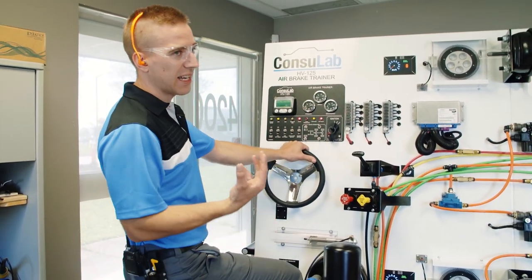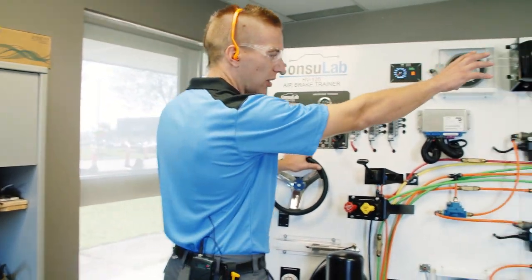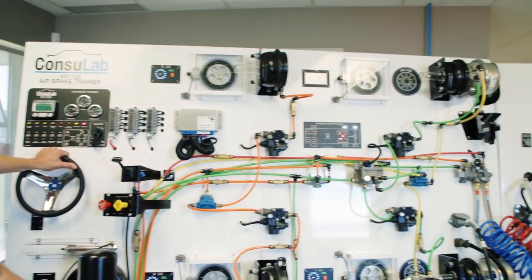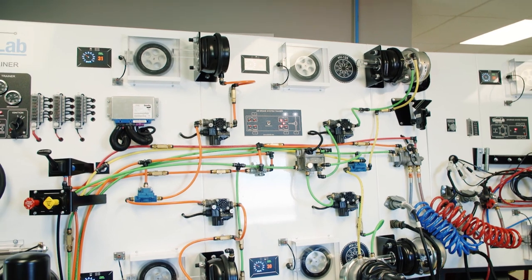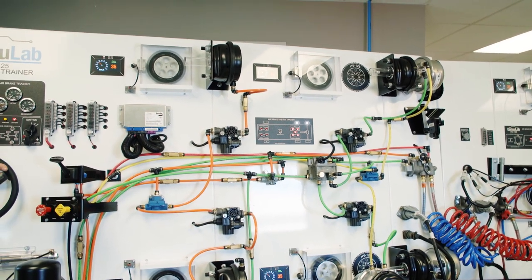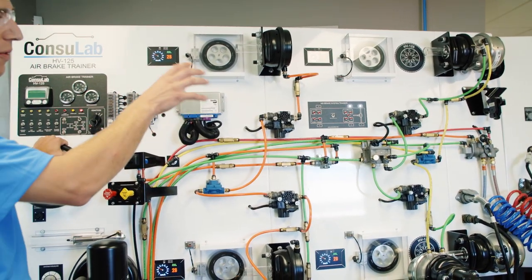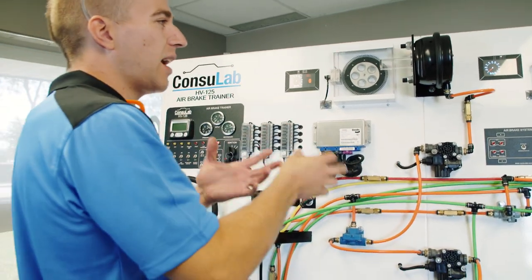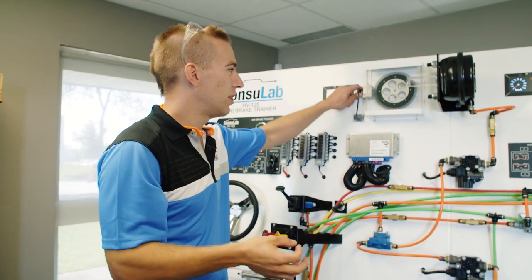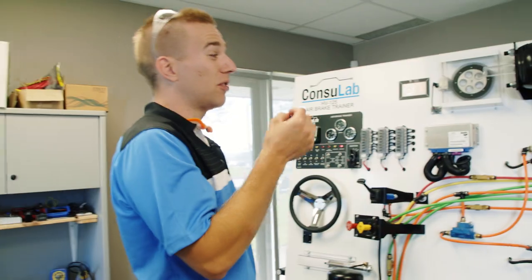Now we're still on ice, so if I hit the gas pedal and we're still on ice, what's going to happen? If we take a look here, the wheel spins because we're on ice. The traction control system uses the brakes to slow that wheel down. We have individual screens with individual wheel speed, and the wheel speed is not faked or simulated — we're using the real sensor with a real tone wheel with a stepper motor that's going to spin it up to the real speed.